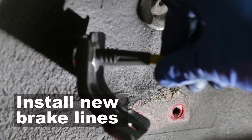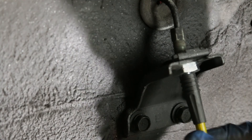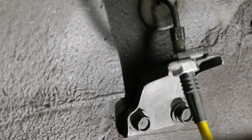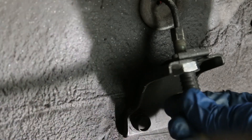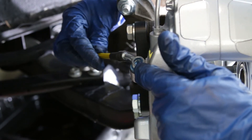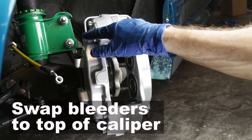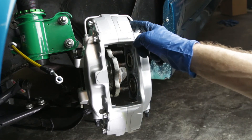The bracket is attached to the brake line with a clip, so I'm going to remove this clip and then put the new brake line on. The clip is attached, the new brake line is attached. When you're attaching the brake line to the bracket, don't worry too much about which way it goes — this thing does rotate nicely. When you're putting the brake line in, just make sure that the banjo end is facing downwards. We want to take this line and move it to the bottom and take these bleeders and move them to the top.